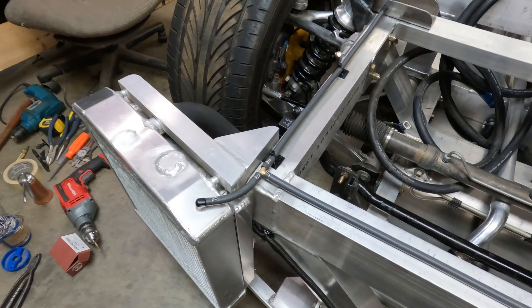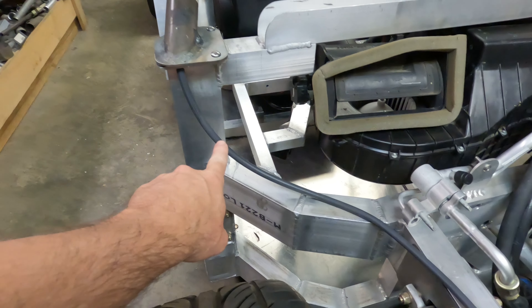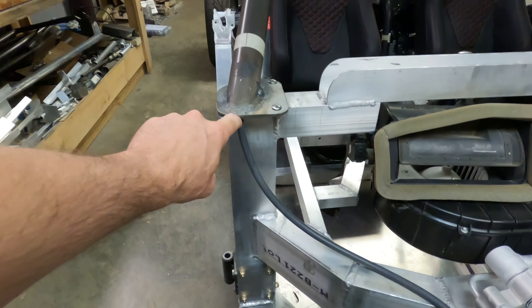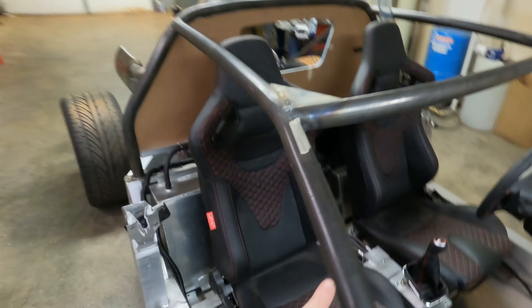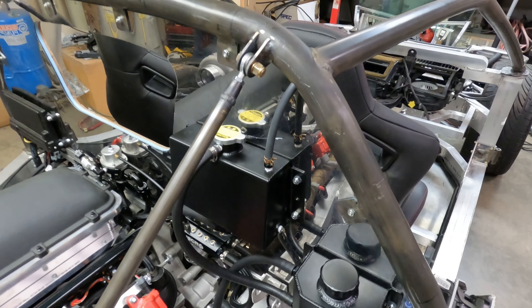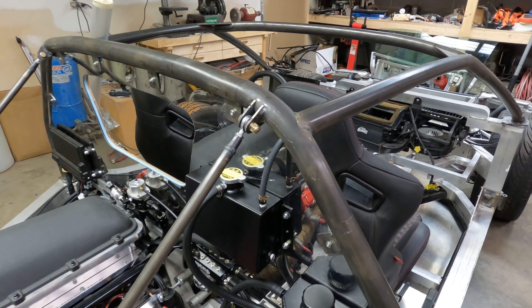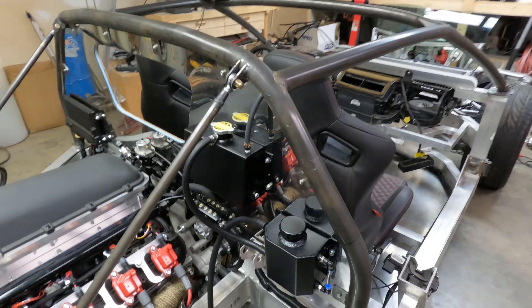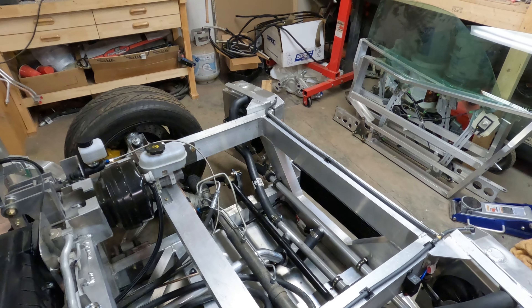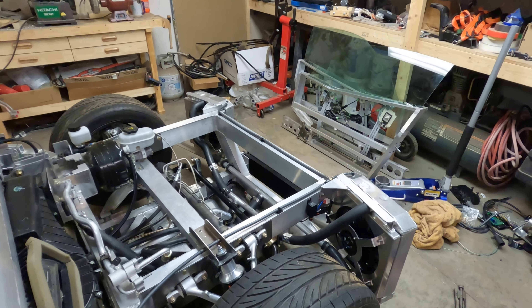I plumbed in these vent tubes — they come here to a tee and then run back along. I needed this tube to be as high as possible to let the air escape without the fluid or water in the radiators. I've actually drilled a hole underneath this base and I'm running the hose through this tube of the roll cage, all the way back, and drilled a hole here for it to come out and run back into this collector tank or header tank. That lets the trapped air escape, and just in case it forces any water through the tube, it'll come back and reclaim it in the header tank. I ran the engine for quite a while and it seems like the water is flowing through both radiators — the temperature stayed around 210 to 215 and never got above that. So the radiator plumbing is going to work fine, and I'm going to say we are finished with the radiator plumbing.